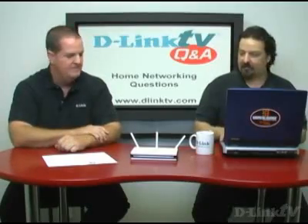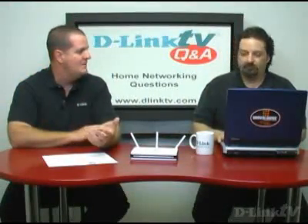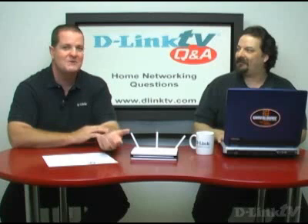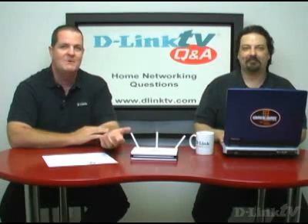The key is to try and get stuff that fits into the same family. The DIR-635 was from the Range Booster N650 family. Keep in mind that 54 megabit is the raw data rate — your actual usable throughput is probably in the low 20 megabit range, which is still far faster than your internet link is going to be unless you've got the most screaming-hot internet connection out there.